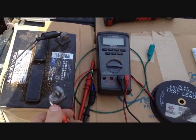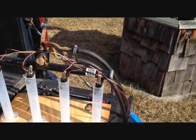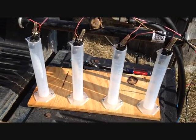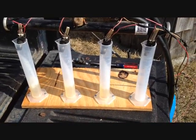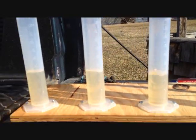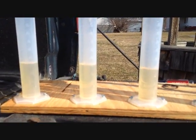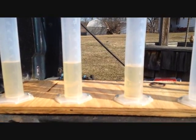We're going to hook this up. You can kind of hear it going through its thing. Static flow test — here we go. Hey, I got three of them working! Shut it off. Let's take a look: number one is at 44, which is what it did before — it was at 45, so there might be just the angle it's sitting at. The others are still dripping, so I think they're junk, or they've got dirt in them. So, 44, 44, and 44.